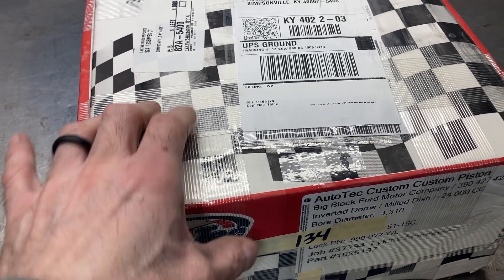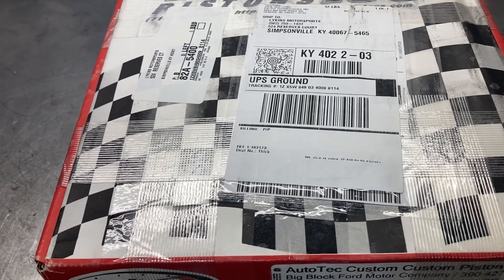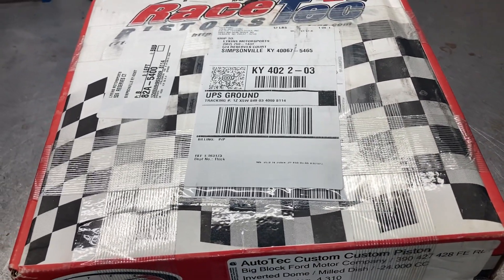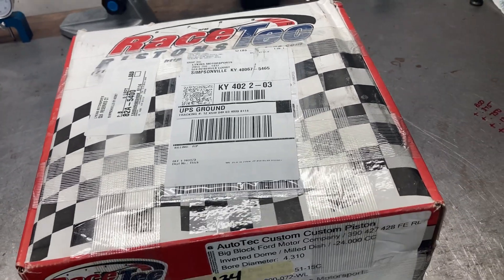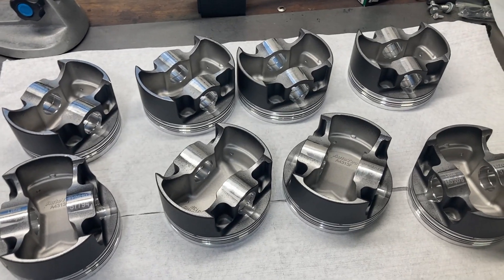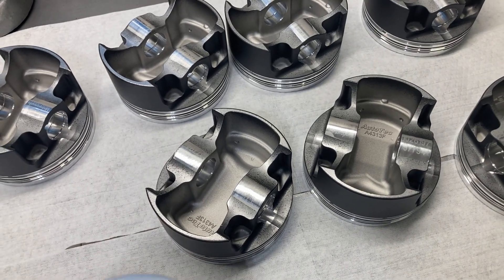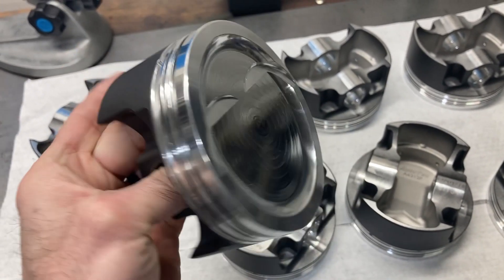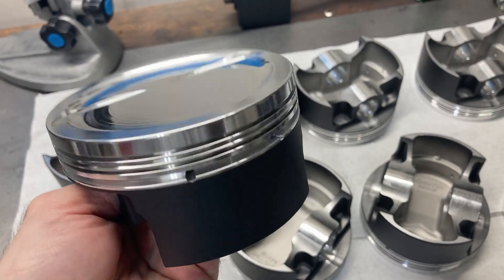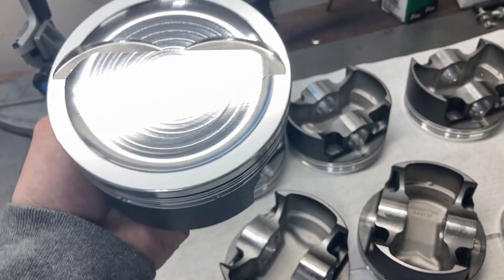In this video we're going to take a look at these pistons. We're going to look at the Molnar rods — we've already done the rod bearing clearance check on them — and we're going to do some weighing, measure the skirt diameter, and get everything set up so that we can hang the pistons on the rods and get a bob weight to balance the crank. Mr. Dennis requested the skirt coating, which is an anti-friction, anti-wear coating on the piston skirts. Racetech does not do any coating in-house, so we send them out when we want them done this way.